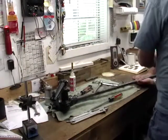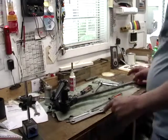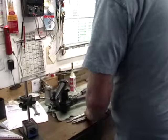What are you doing? What kind of gauge is that? Just a feeler gauge, right? Depth gauge? No, it's a, what do you call it? Dial indicator. And what are we indicating besides that dial? We're going to see movement here. Yeah. Either side of center line. Right. That's when you're going to see how much slop you have in that steering shaft. So you want to see how much movement you have before this gauge moves. Either way. Well, didn't you just do that by moving the arm? You can see we have some slop now. Yeah. So we'll have to take that out.